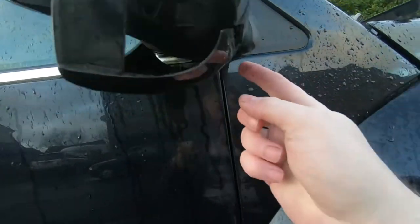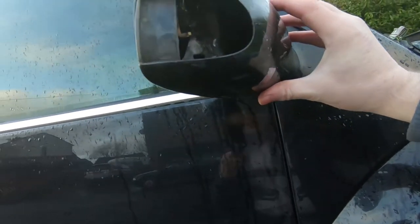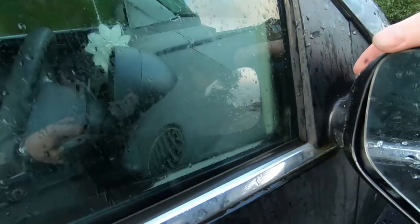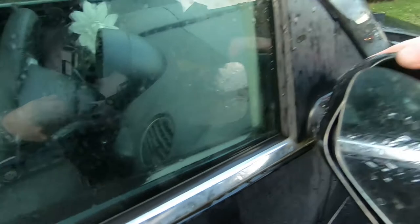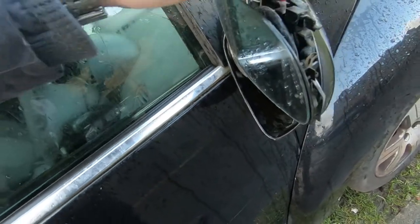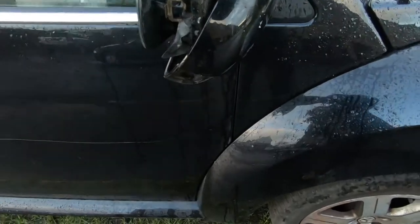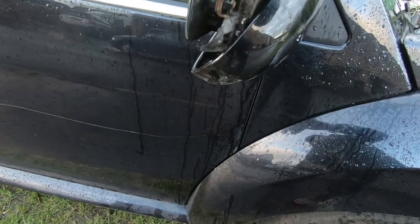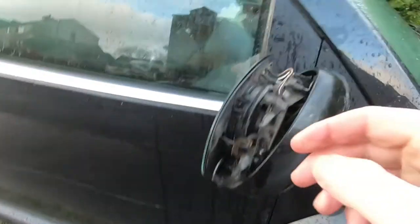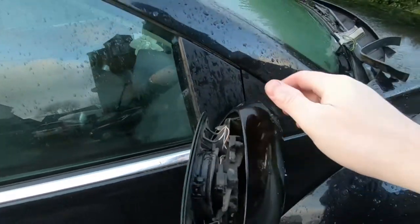The only other thing I can see wrong is it's just cracked, so I should be able to stick that back together with Araldite and that should do it. What I'm going to do is try to get this off without damaging it any further. I think the only way is to get the mirror off because the rest of the mirror works and the assembly is fine - there's nothing wrong with the bracket and the motor still works for adjusting it. If I can just get this glass off, I think it's just held in by a few tabs.